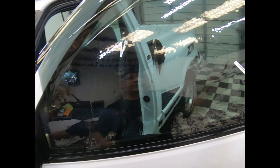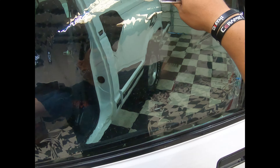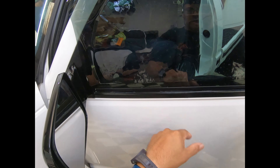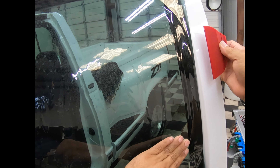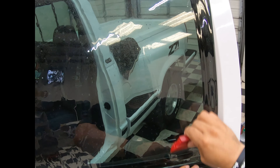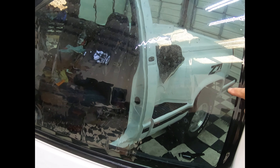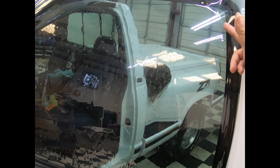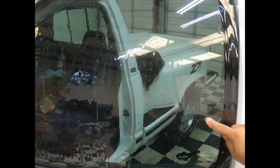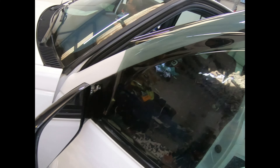There is our pattern — as you can see there's going to be fingers and distress everywhere. Go ahead and raise it up a couple of inches from the bottom so that we can push all the fingers all the way to the bottom. If you don't push the fingers to the bottom, you're going to get fingers and a lot of dirt particles — when the water seeps down it collects all the dirt, and when a finger pops in it'll introduce all that dirt into the finger and mess everything up.